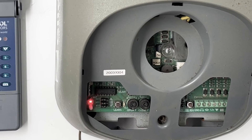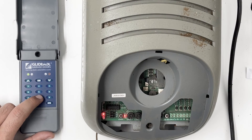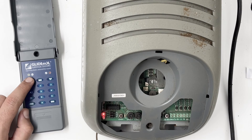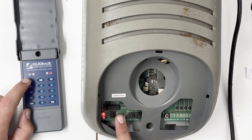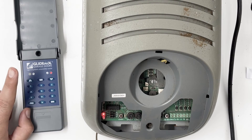After pressing the learn button, the light will go out if you're too slow, so just hit it again — the light will stay on for a bit. Type in the pin we set, which is 2-5-8-0, and that should unlock the keypad. The learn light will go out but it's sending a signal. To code it in: make sure the learn light is on, press the button you want programmed, press it again to make the door operate, then press it again.